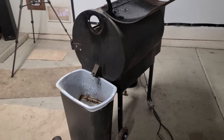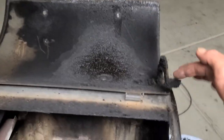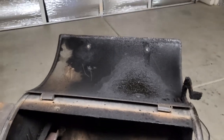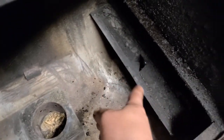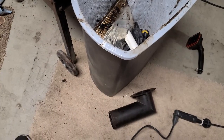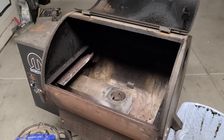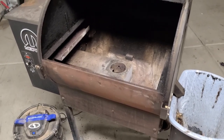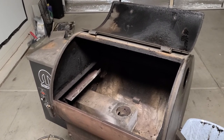So here's how far I got in day one. I was able to get this thing pretty well pulled apart and identify all the areas I need to work on — including the beer spot. On the older models, all you do to bring the lid up is pull this piece in and it just comes right up. I got the handle off, our auger all emptied out — well, almost, that's the last of the pellets. Got this little tray down here cleaned out, the front's starting to get sanded, cleaned out our flue, and getting ready to make my gasket — I'll show you the process of that on the next video. I appreciate you guys watching the channel; part two will be coming tomorrow. Hit that subscribe button — see you next time.